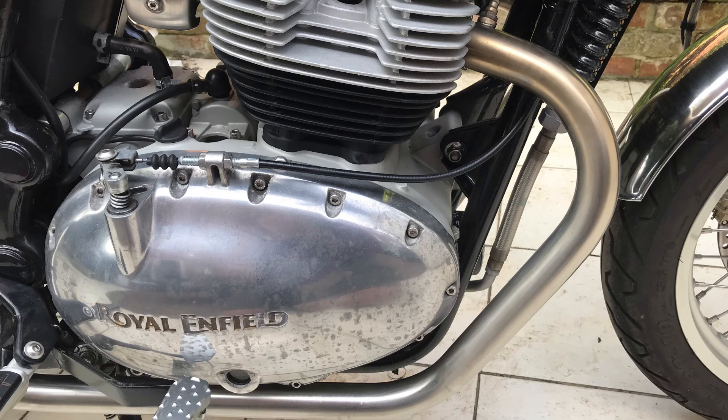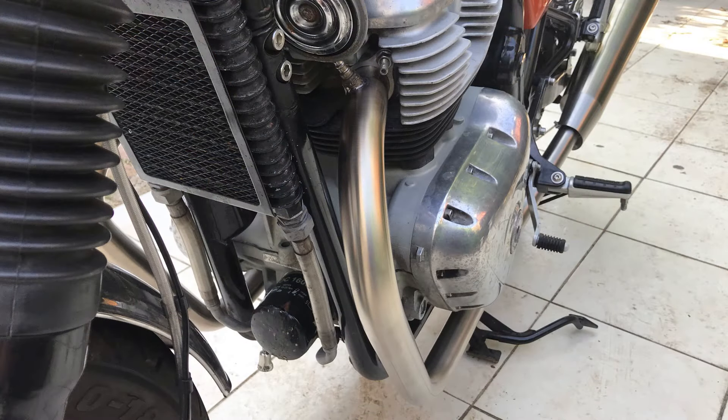I've fired the bike up and let it run for 15 minutes. People have said that the ECU will recalibrate itself based on the change in the exhaust system if you let it tick over for 15 minutes, so that's exactly what I've done. As you can see in the picture, the lambda sensors fit straight in where they should. I would strongly advise removing the block terminals — they're accessible without taking the tank off, though taking the tank off makes everything easier. Unplug them rather than turning the lambda sensor through six or seven rotations and twisting those very fine wires. The Stratus instructions said to do it that way, but in my opinion that will just twist your wires.